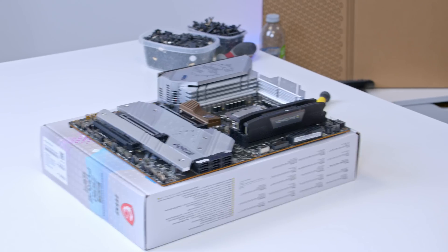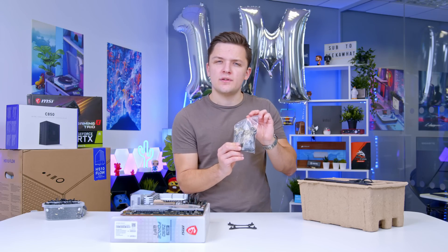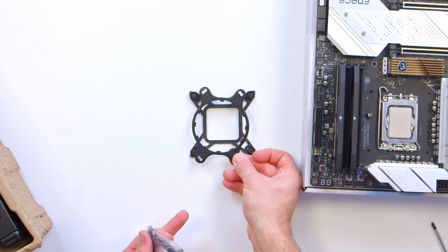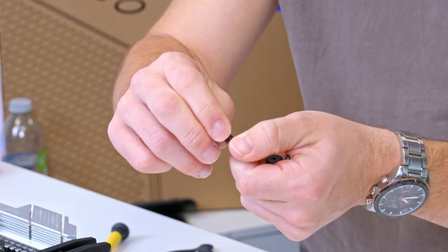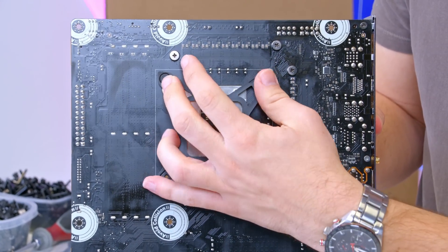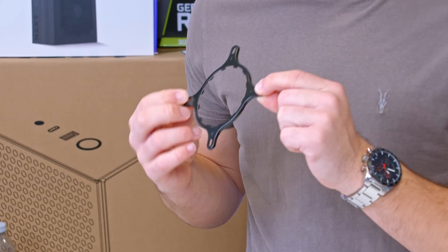We need to unbox the CPU cooler and identify which parts to worry about now. First is the backplate — a plastic flexi backplate that provides the mounting holes for our NZXT cooler. There's also a bag with metal rings, thumb screws, and posts. Take out the correct ring for the Intel CPU by seeing which ones line up with the backplate. You'll also find little doodads made of two parts: a male-to-male screw and a large thumb screw on top. Add the backplate to the rear of the motherboard, screw in the male-to-male posts, and loosely add the thumb screws — we'll remove these later. Keep hold of the mounting piece, as it's needed very shortly.